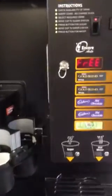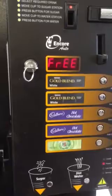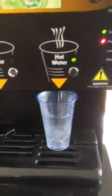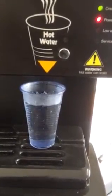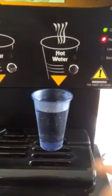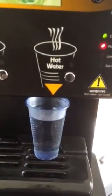And we take that switch back down to run. Then we'll just try it again — let's make a drink. Put one under there, just like water. And there we go — you've got an increased cup level. But if that's too high when you've got the proper cups in there with the ingredients in it, then just drop that time setting down a little bit.